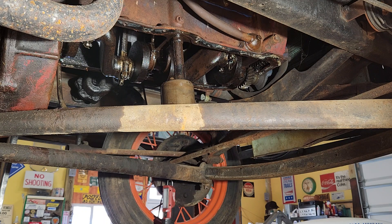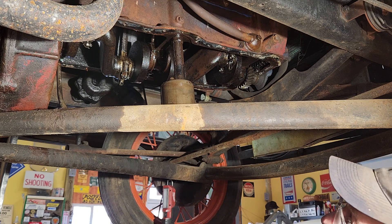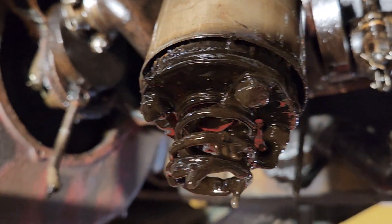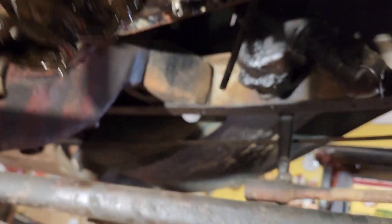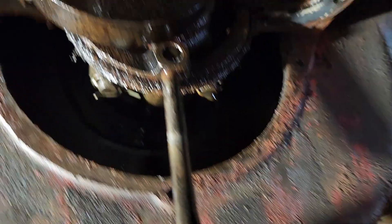Put my little brick back in here — I've got a little brick for a while. Let's see what we're looking at up on the inside. We've got — well, you can see she's dirty. Oil pump screen — looks a little sludged up. Let's see — here's your return tube. Yeah, a little something like that.